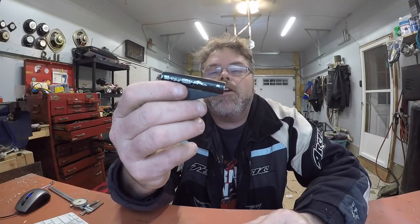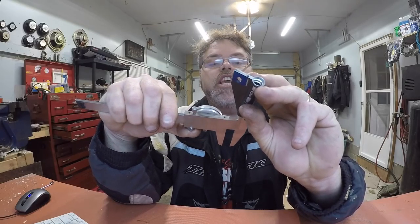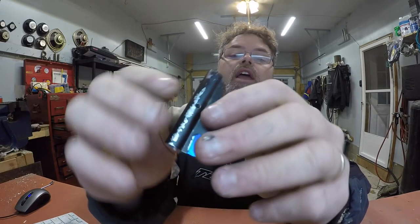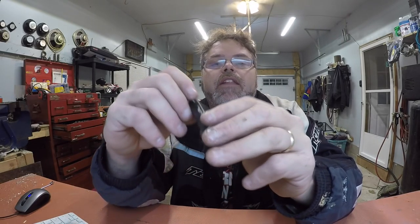I'll be back in a bit once I figure out something else to do. I did stick around with something — I'm working on the boat. I had the old output shaft for the old Spartan, and you know how they have the brass bushings in them that wear out? Well you can get ones with bearings in them, but what I did is I just drilled it out and ordered some bearings to save some cash — bearings are cheap. I did a pretty good job freehand with the drill. I already took a bearing out of the Slash just to try it, and it slides right in.